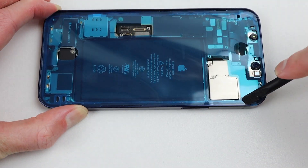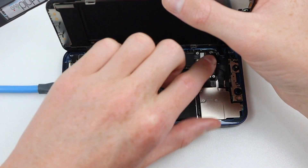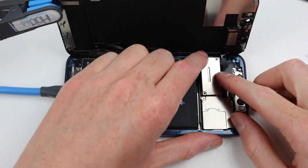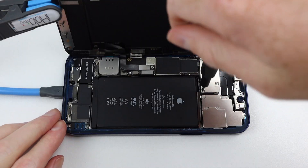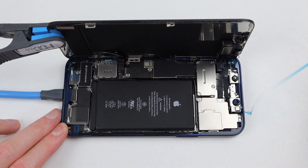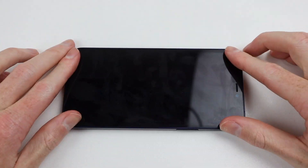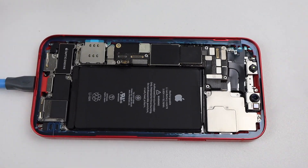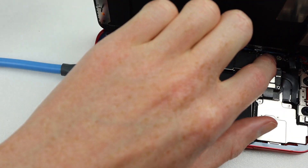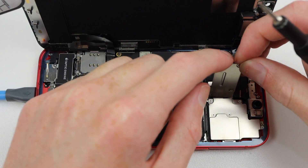Once all the old adhesive was removed, I got the new water and dust resistant seal installed on both housings before attaching the displays. Using a spudger I could correctly seat it in place. Removing the protective film, I attached the display panel and connected up the display, digitizer, and earpiece cables, then reconnected the battery and the two cowlings over the connections. One indispensable tool when working on iPhones is an i-hold, used to hold the display in place while you connect cables and screw everything back into position.